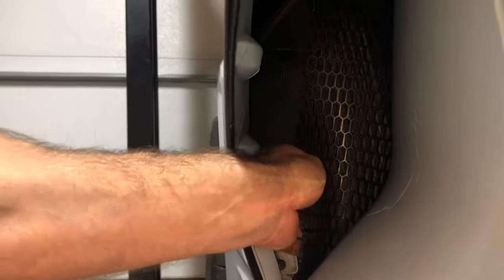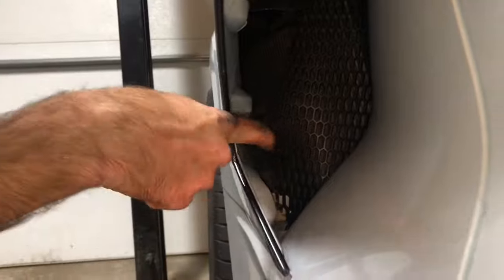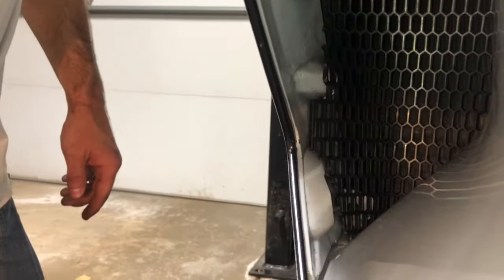To get in front of the body mount screw at the bottom — the body mount screw is there at the bottom — bring that forward and position the grill so that this outer flat piece ends up in between this bump and that bump. You can also use an allen key to pull the grill screen forward if you need to.